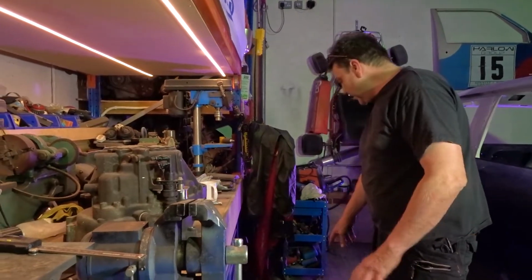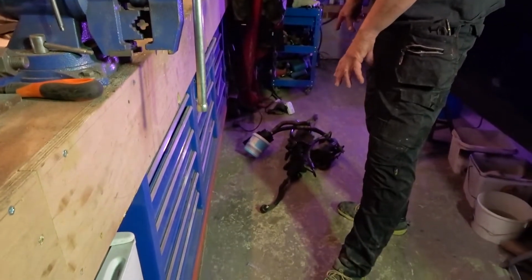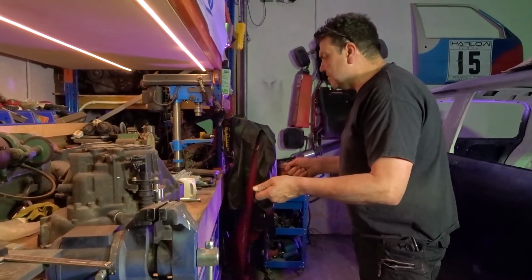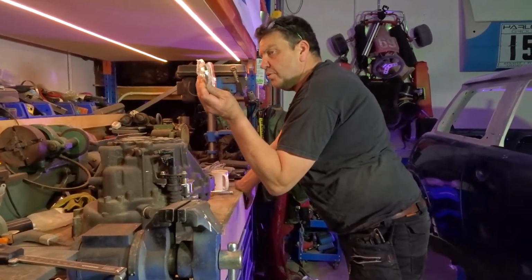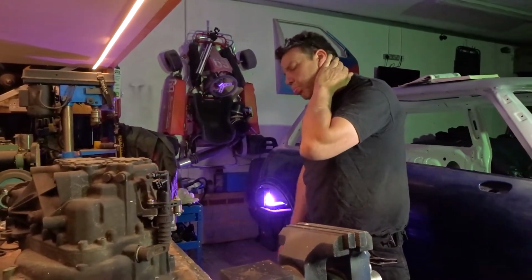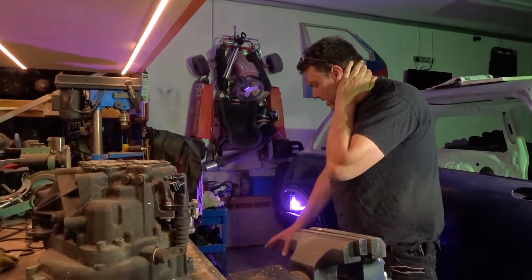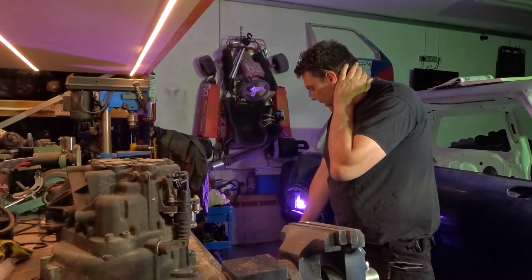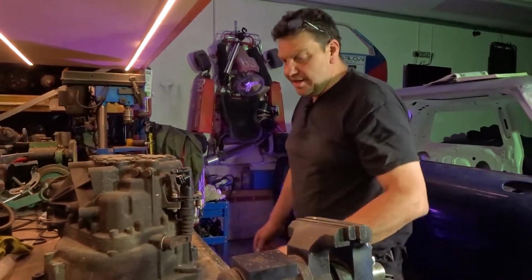Yeah, so we're going to... I mean, the steering rack wants all stripping down and clearing up. We're just going to change one end of it, basically, the inner and the outer, and put new boots on it. But I'm just going to put the boots on and tie them up with cable ties for now. I've got the proper metal clips that you crimp on them once it's all done, but I'm not going to do it because we've got to strip all the gearbox down. Strip the steering rack. Not strip it down, but take it apart and clean it up, basically get all the crap off of it, and put new copper washers on the banjo bolts and stuff like that, and clean the plate up. And usual, really, you know, don't you?